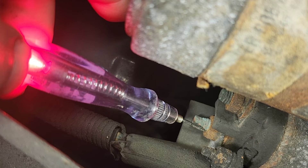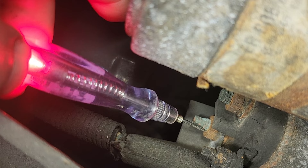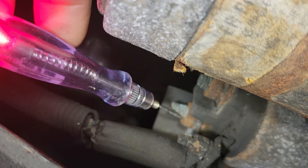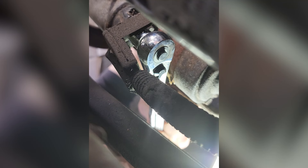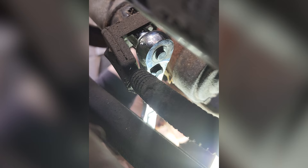Go ahead and crank it — that's awesome. So literally all we need to do is take that nut off, clean it up, and tighten it back up and this thing's going to start. This is classic voltage drop stuff here, Caleb. Love it, love it, love it. Me just snugging that bolt up right now would be enough for us to get this going.